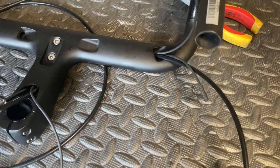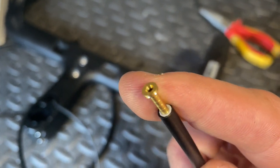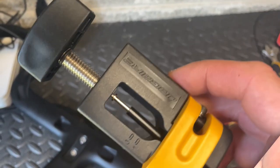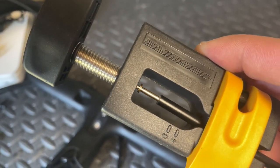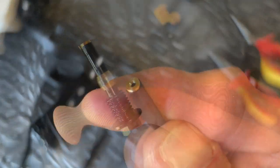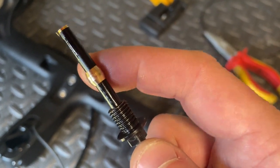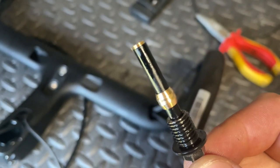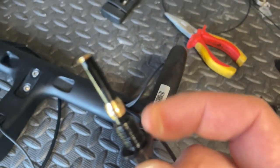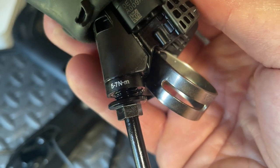What we'll do is we'll pull that through, connect the shifter up and then stick it on. First thing we need to do is drive this needle in. We're set up in the needle driver and we just screw that down and it'll push the needle in. The needle is now home. We've got the bit from the lever, the screw-in for the lever body, the olive and the needle. We'll put that into the SDI lever and then screw it up to five to seven newton meters.